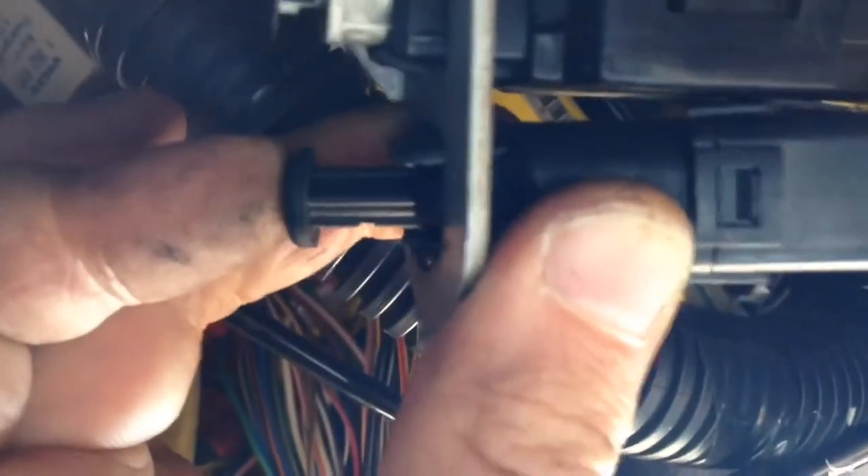Got the last bracket off. There's a slight difference to the other car. This item here is your brake switch that turns your brake light on when you touch the pedal. This one here is a little vacuum sensor for the cruise control that the automatic car has — so as soon as you touch the brake pedal, that knocks the cruise control off. It's also got a little electrical sensor on the back. Disconnect all of those, and I think we might end up painting this bracket because I'm not convinced the other bracket has the second hole — we'll soon see.